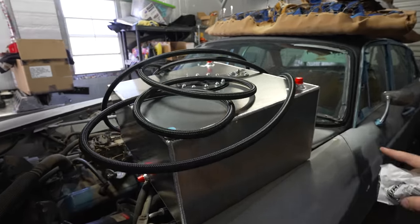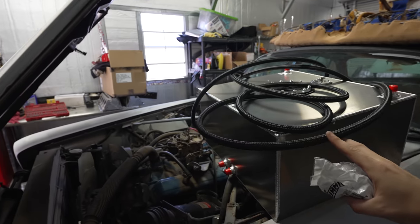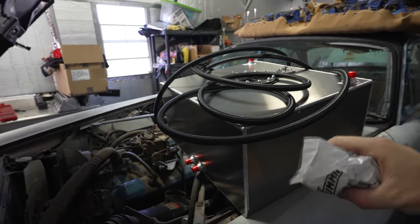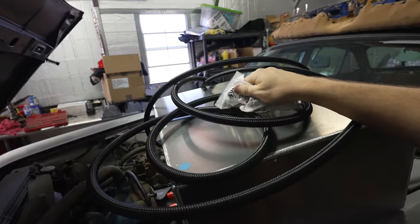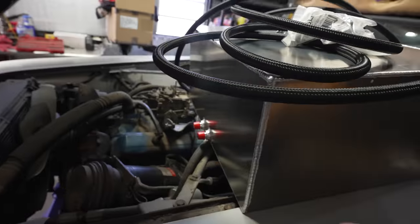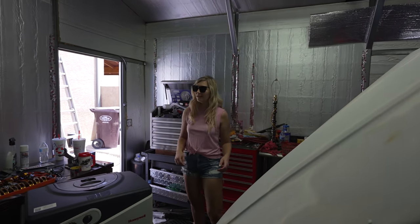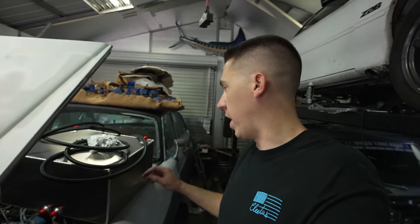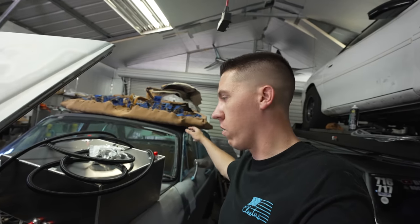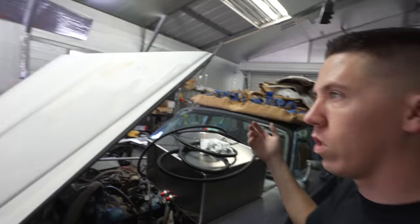We found this aluminum fuel cell that I think will fit in the little slot in the back. We're going with that, and then this nylon braided hose - this is a lot better on the fingertips - and then some AN fittings. This all adds up pretty quickly in price, but everything will be AN on this so later if this ends up going to an LS, which will probably happen eventually, we'll already have at least a dash-eight line ran all the way to the front. All we'll need to do is plumb in a return back to the tank. It's got a fuel sending unit on it too, so if she wants to see fuel level in case she wants to cruise this thing around.